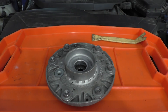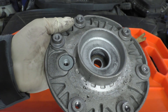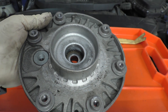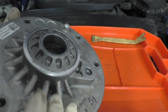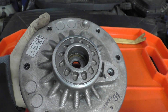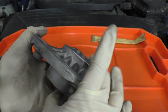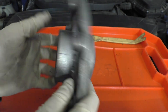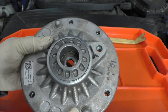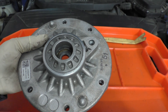We'll take this and press it onto the Millway camber plate until it snaps on. While we've got the OE top mount out, let's take a closer look at it. Right where the piston shaft goes, you can see a little bit of black around the periphery, both from the bottom and the top side — that's the rubber encapsulating that metal plate or washer that secures the shaft. This thickness of rubber absorbs vibration from the damper instead of transmitting it into the top mount, shock towers, and chassis.